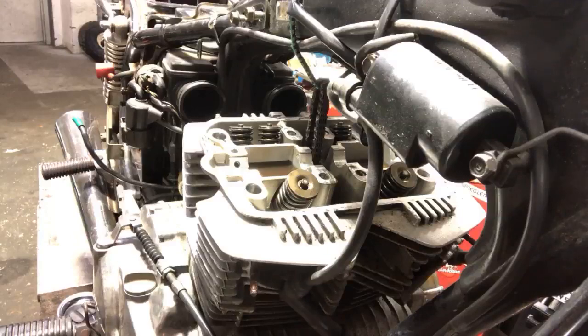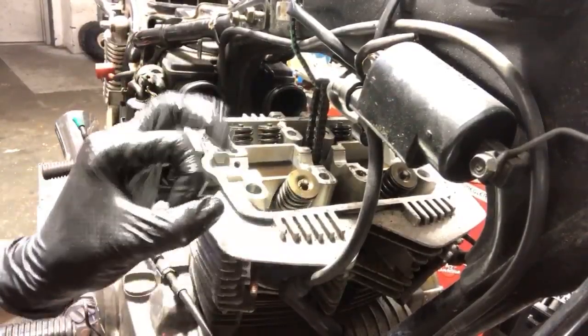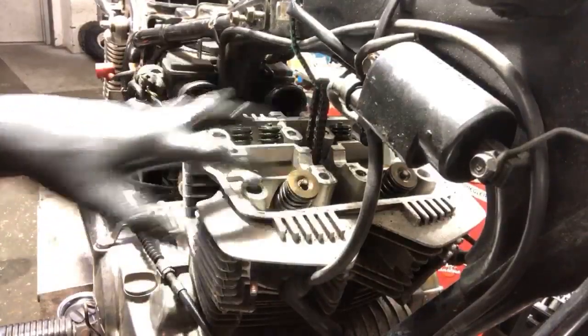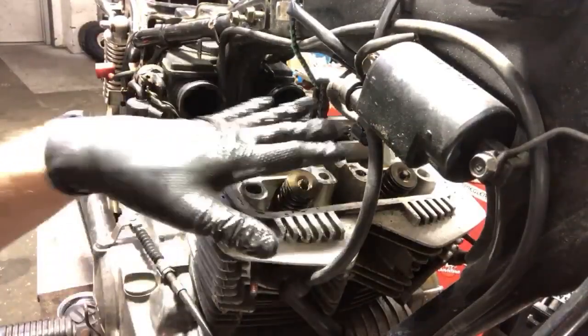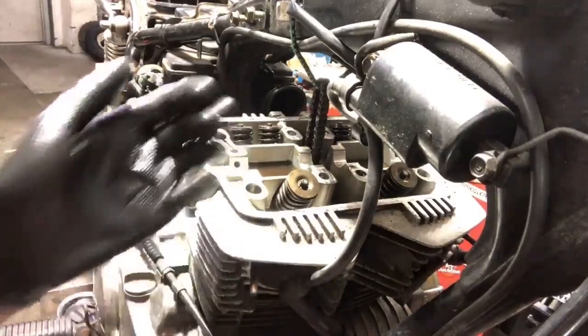Are they different in structure? It all depends. Some heads have a two valve system on the intake like this, and one exhaust. So they have one big fat exhaust valve and two smaller intakes. Some have a four valve system, two exhaust, two intakes. Usually the intakes are bigger or the exhausts are usually bigger, it all depends on the motor. So there's a bunch of different setups to make it more efficient, more power, and lack thereof, but they're pretty much the exact same thing, but the diameter of the head on that valve is what will be the difference.